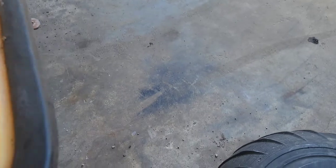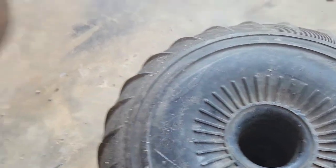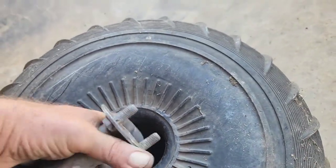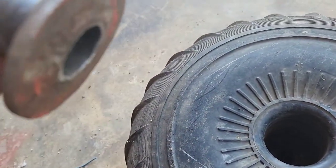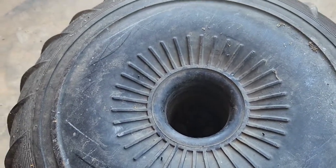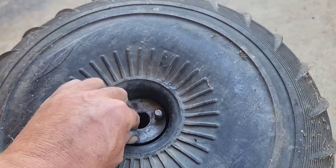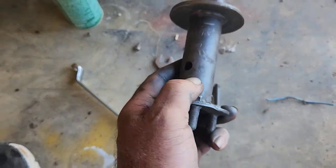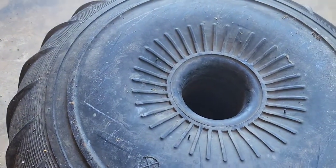What I've been working on — as you know, I had a lot of trouble getting just a couple of these tires off. It had to do with these hubs. These hubs fit perfectly in the metal rim, but a couple of them got really stuck when either this part gets a little deformed or some rust gets in there, and causes those tires to really kind of jam up on there. So I went ahead and ground that down, and now as you can see it slips in there beautifully. Of course you lube it up. I went ahead and did that with all of them, so now all of them fit in all of their respective tires.